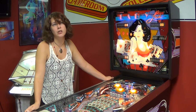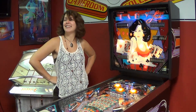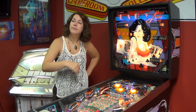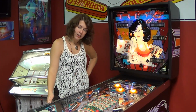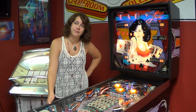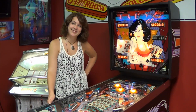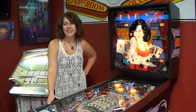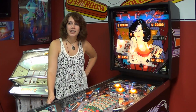If it looks like a beat up piece of shit, it's gonna play like a piece of shit for sure, and that's across the board. Yeah, but we don't do that here. I'm always critical, but I'm extra critical on a game like this where there isn't much else going on. It has to be clean and have all the lights redone. Theater Magic, when it came in, had an upper lane switch that wasn't working. It needed a micro switch. You could still play that game, and the general person wouldn't even notice or care. In this case, everything's got to work exactly right, or the game just falls on its face.